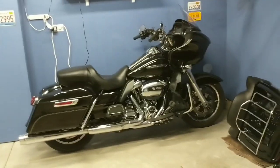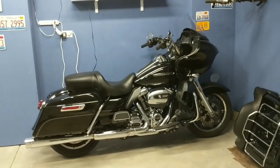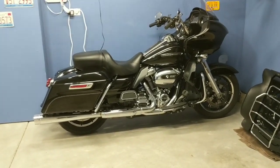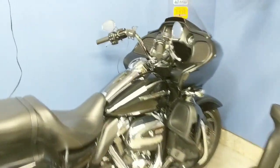If not, if they're just a couple months old, just from the last season, make sure everything's topped off and worry about it in the spring. Change the fluids in the spring. This applies to, if you've got a Harley, your transmission, your primary, and your engine oil. Make sure they're good, and then that's it. Forget it. Fuel tank. You're going to want to top off the fuel tank and add fuel stabilizer.